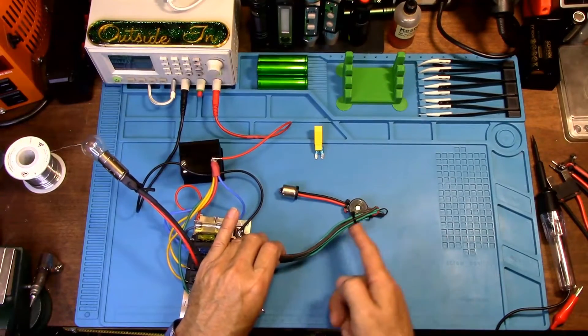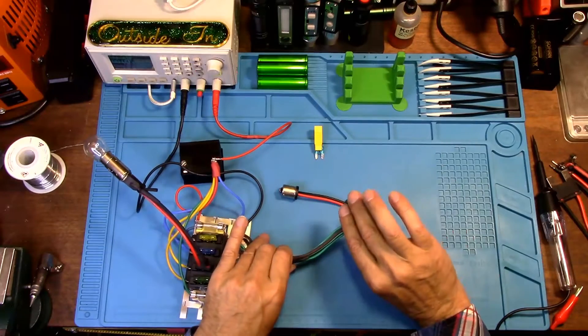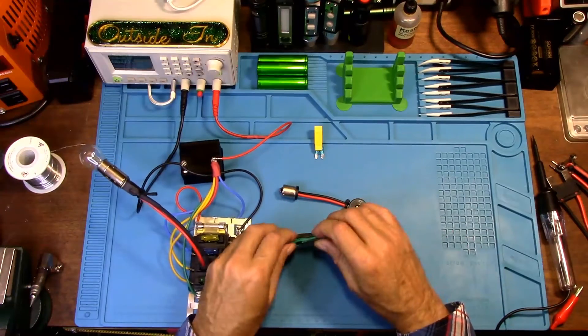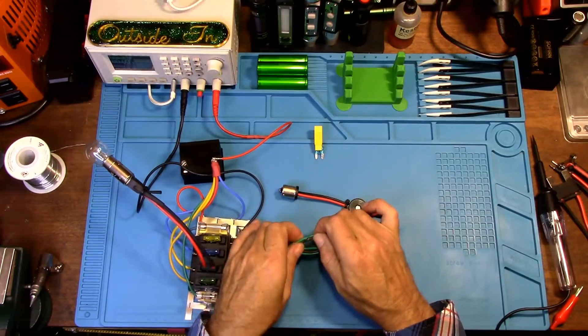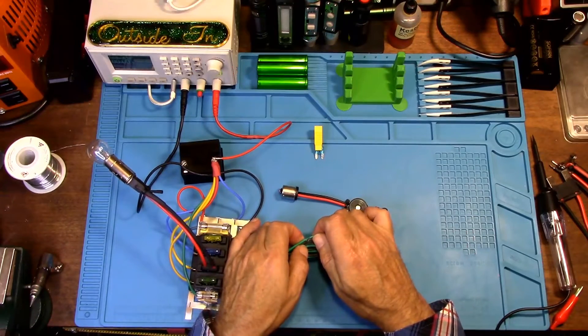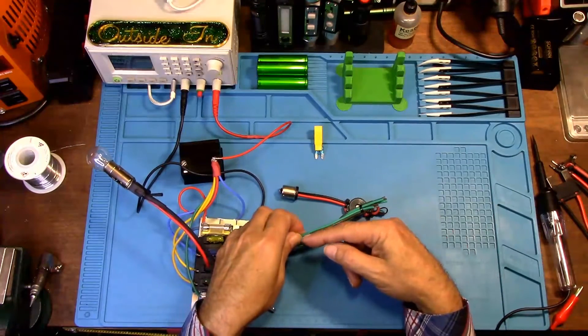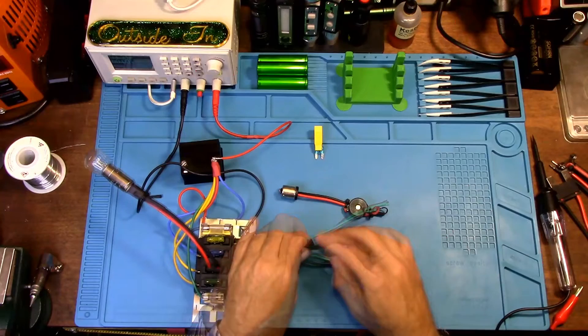When you get into your wires, you're going to look and see — uh-oh, there is where the short is. Then you can just pull this apart and take some electrical tape and tape up both sides to fix it. Just make sure if you do decide to cut this, you are able to put it back together to splice it.